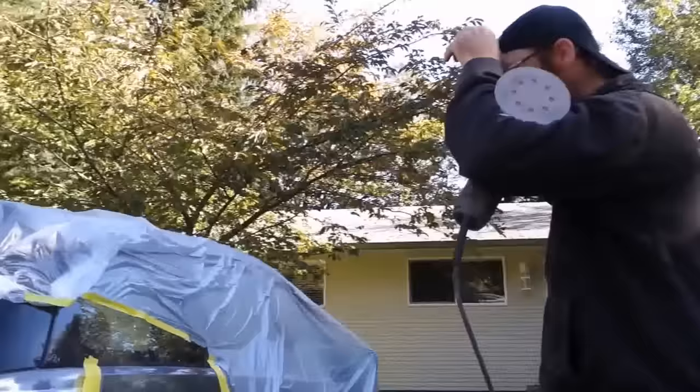I like to prime at about 400 grit, and it's not doing any real filling anyway, it's just to take minor sand scratches. This way, I'm more comfortable priming over top of the 400 grit than the coarser. So when you just sand the paint coat directly to take scratches out, what do you use for that? Also 400? 400, yeah.